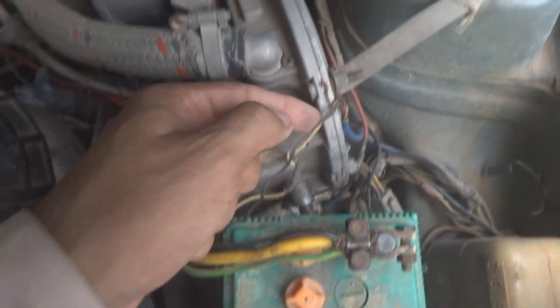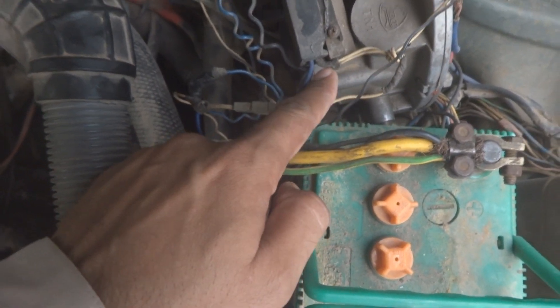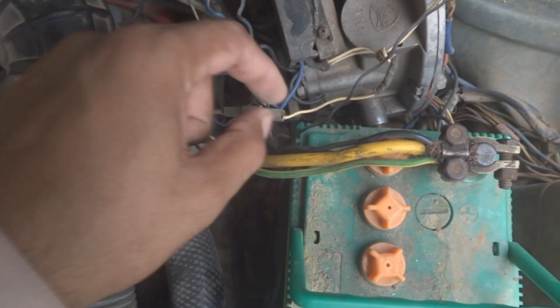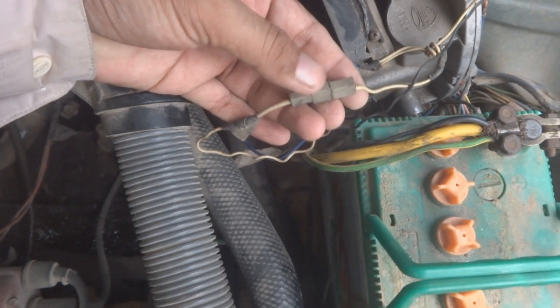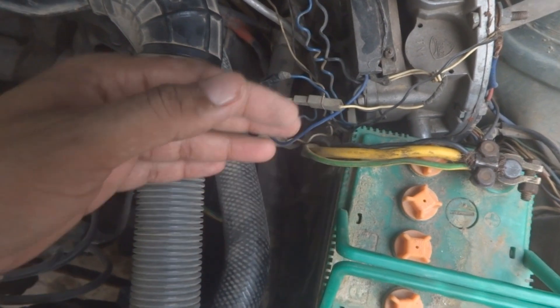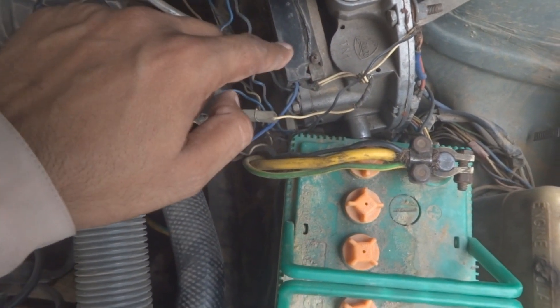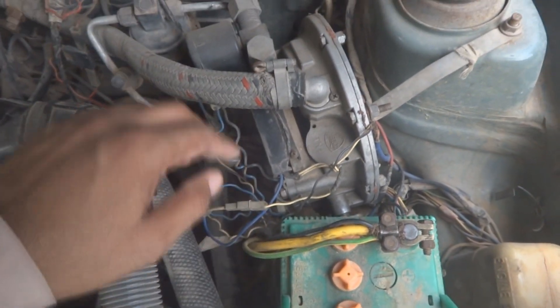This wire is grounded on the kit. This is one wire coming from the potentiometer — one side of the potentiometer is 12 volt, the other side is grounded, and the center wiper connector is over here. We will get a variable voltage from 0 to 12 volts, depending on the gas quantity in the tank, because the pressure is proportional to the gas quantity.